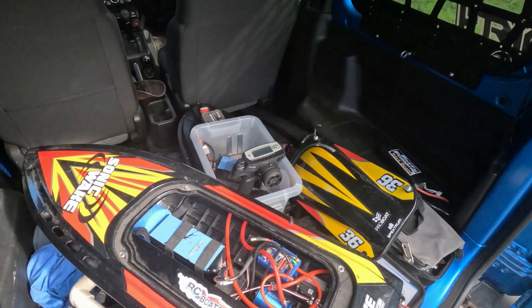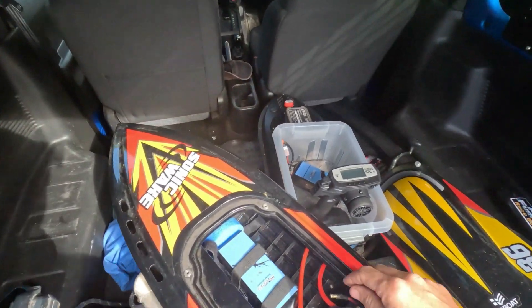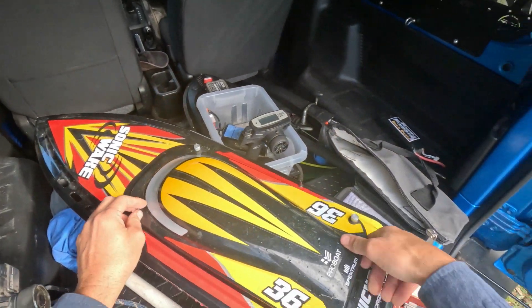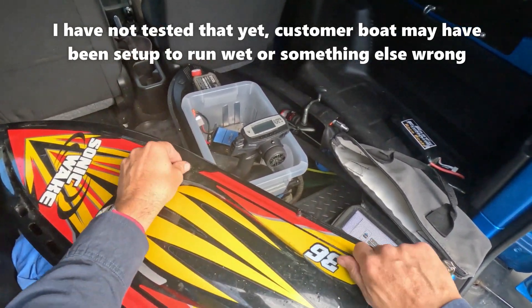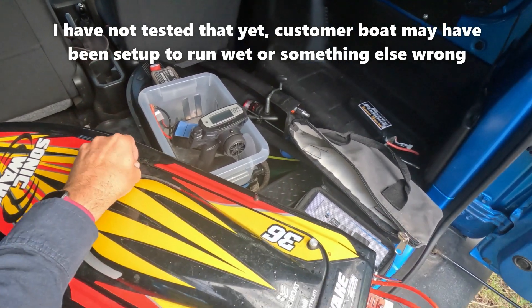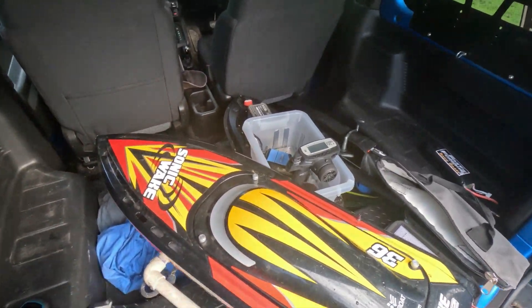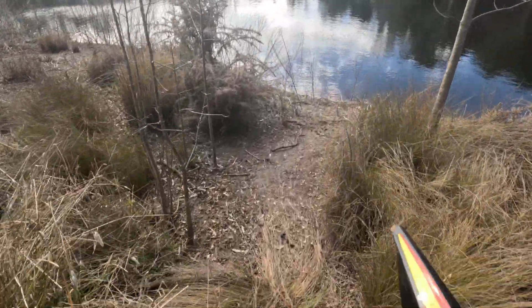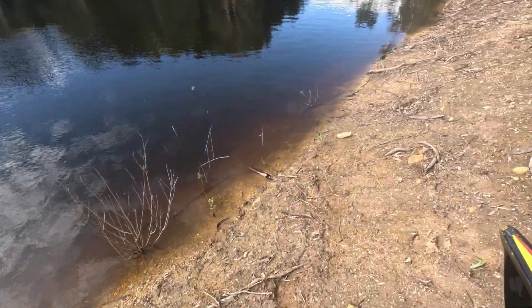It's not the fairest test using the same battery on all three props — I'll do a better test next week, with a Dash Voter prop as well which a customer sent me. He said it was good but only used it once because it made everything too hot, so we'll find out with a temp gun next week. I know that last prop did 99 km/h in my Impulse 32, so that's the difference between this Traxxas running gear in a boat it shouldn't really be in — about 20 km/h off. Let's see what this bigger one does.